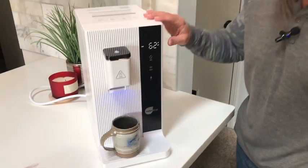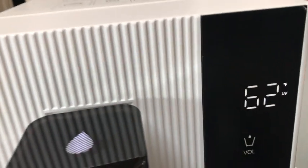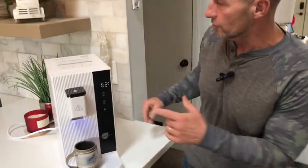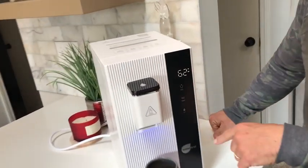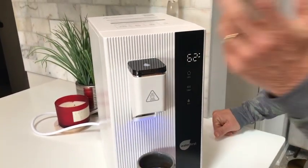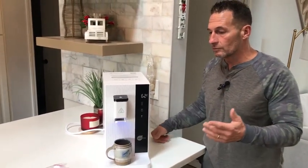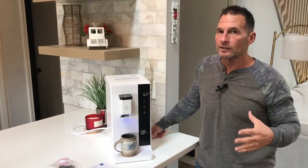As far as the simplicity of it, it will also tell you if you're low on water — an L1 will come up and you'll know you need to fill it up. When you first start it, it gives you directions. Obviously it comes with directions — real simple to use. What you're going to do is run through the water a couple of times. If I click this button, it gives me all the highlights, and then I'll push and hold that button. It'll give me a blinking HH, then I push it and it'll drain some water out for the first couple of times to circulate the water through. Once I've done that, it's good to go. It does give you suggestions about when you should change your filter and things like that.